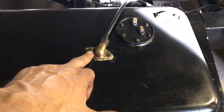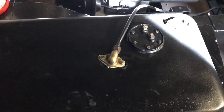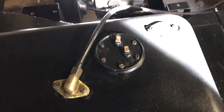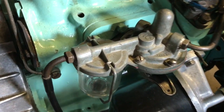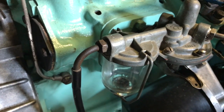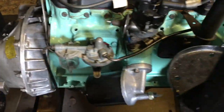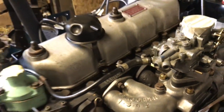That was my fuel pipe off the car already. There's also — I don't know what it's called, a pickup or something — the tube that goes into the bottom of the petrol tank. My original one had a gauze over it which filters the petrol as it goes out. This one was from the replacement tank, but I've put new gaskets in. I've put in the fuel line — I just took the same one from my car and put it back in.